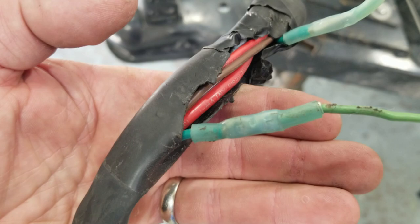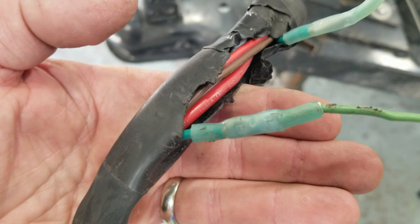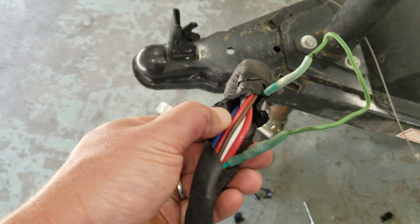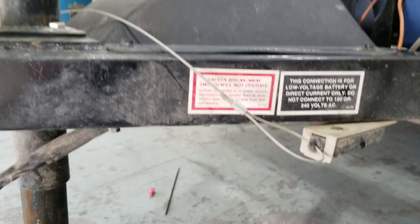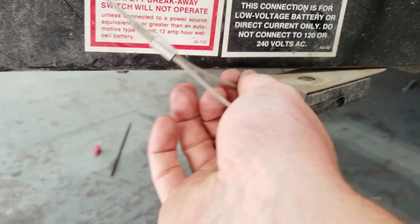And that's just the right turn signal, too. You go over here to the breakaway switch — this is a normally closed switch. We've pulled the breakaway in case the trailer comes off the truck. And now the brakes should be applied from battery voltage. And the brakes are not applied.